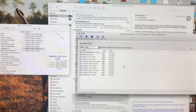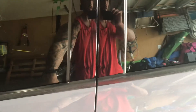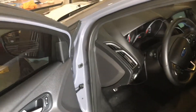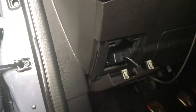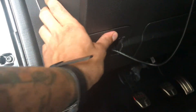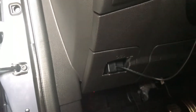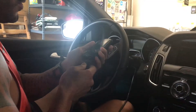All I got to do now is just take my Access Port and put it on the car. Thanks guys, hope this helped. Real quick, also just for those who may not know how to use the Access Port — the Access Port on the Ford Focus RS plugs in right down here. I actually cut it out because I don't like having this flap open. Basically this is your onboard diagnostics port and that is where you plug the Access Port in. Mine stays plugged in. I'm actually in between Access Port mounts right now, so if anybody's got a good Access Port mount for the Ford Focus RS please let me know, because the one that comes with it is hot garbage — it doesn't work at all.